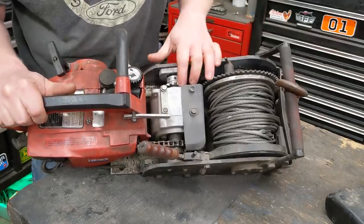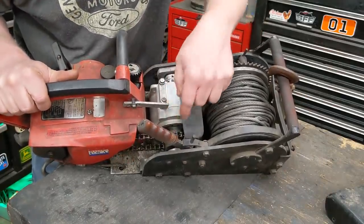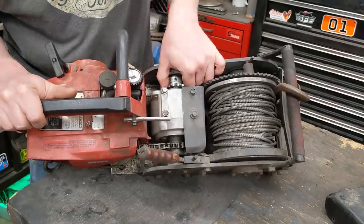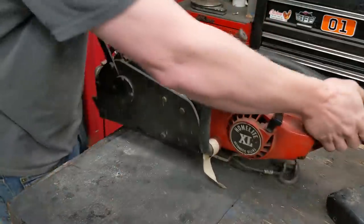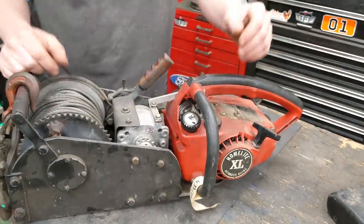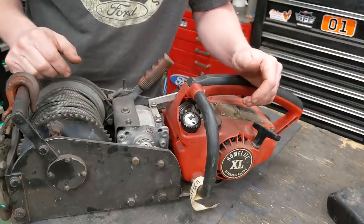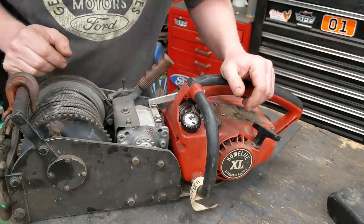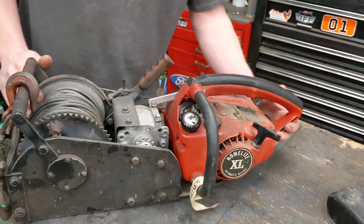Looking at this sprocket and actually looking at the gearbox, it looks like it's been removed and repainted because this gear right here looks brand new, but this gear doesn't look new and this gear in here doesn't look new. So I'm thinking this gear either broke or was so worn that this was taken out of service just to replace this gear, but they already did the work for me. Besides that, this is a Homelite XL — this was not a high-end chainsaw in its day, just a cheap thing. It probably has extremely low hours, but I noticed the air filter is missing, so there's probably a little bit of an engine issue just from sitting so long. It looks like it's been sitting at least 10-15 years.